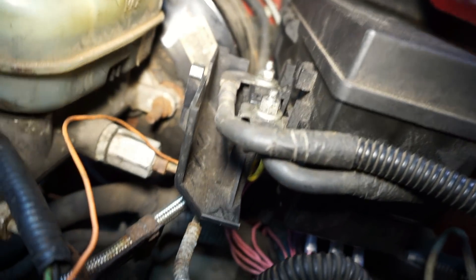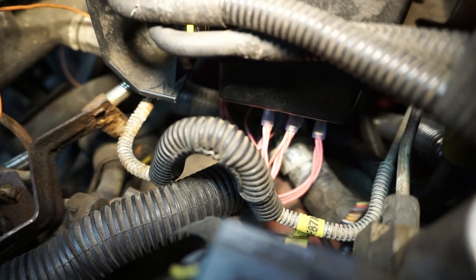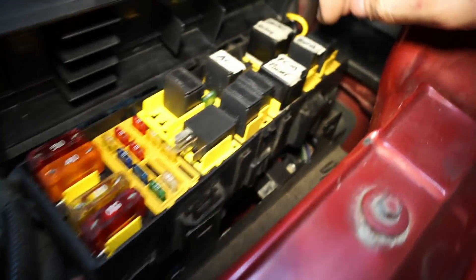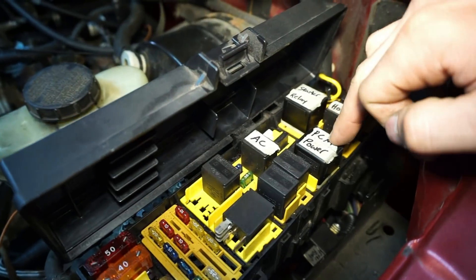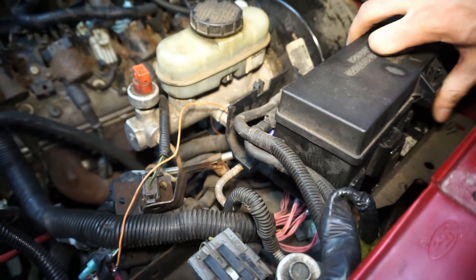That yellow wire is a positive that goes to the relay, which passes power through to the little fuse box underneath. There are five circuits on that fuse box powering the injectors and coils. I could cut that off to kill fuel and ignition, but I also have a separate PCM power relay. I think I'll just cut PCM power to shut the whole thing down, or cut injector and ignition simultaneously so I don't have to worry about hydro-locking.